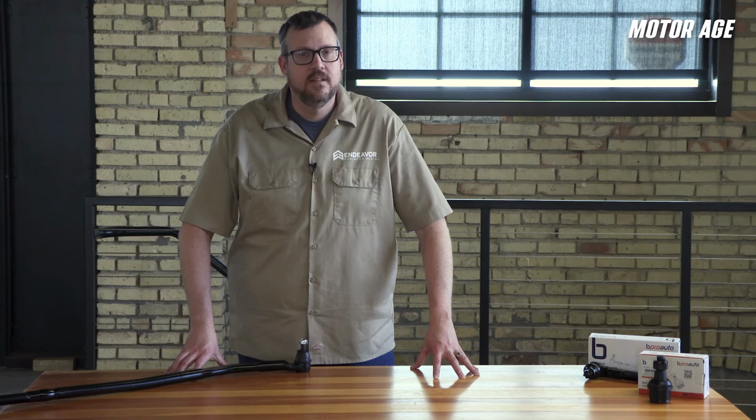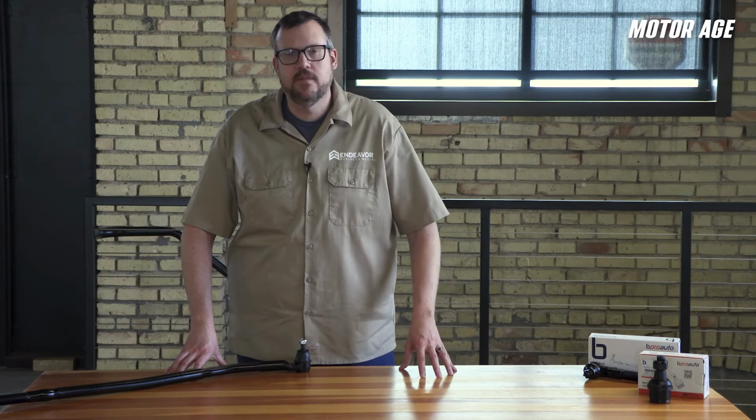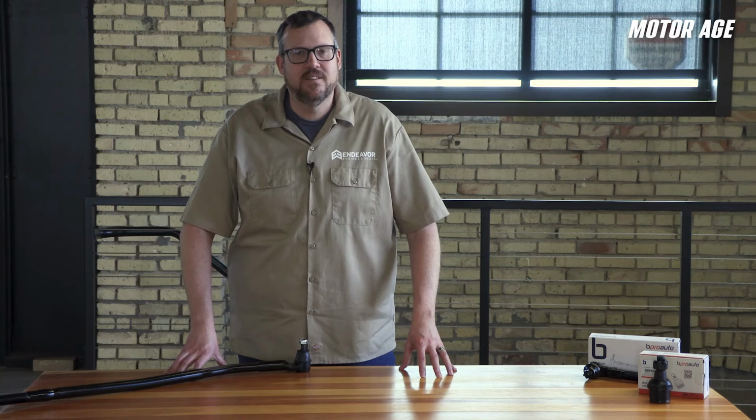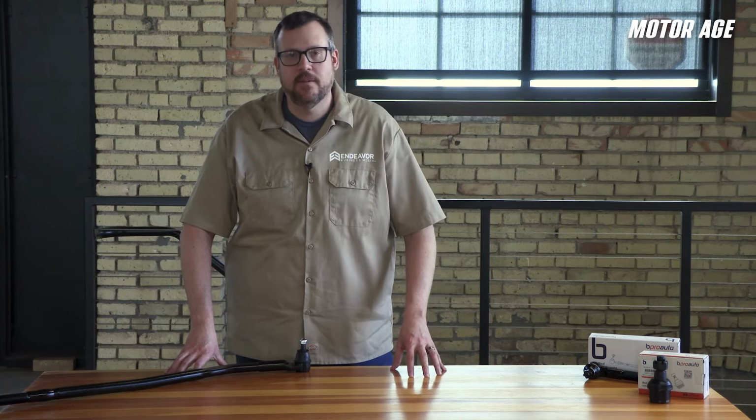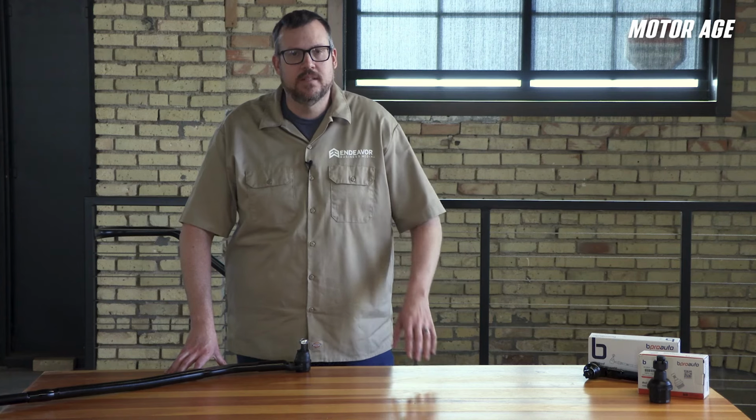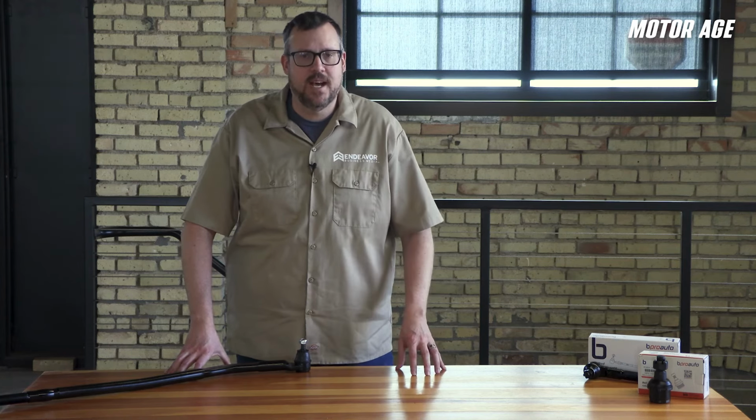Solid axle suspensions, like what you'd find in something like a Jeep Wrangler, have a little different design. The axial load-bearing ball joint on a Dana 44, like in that popular JK Series Wrangler, is the lower ball joint. The upper ball joint is simply a follower design.